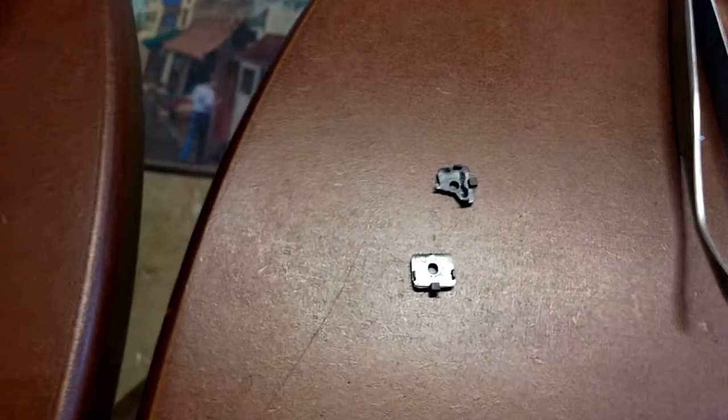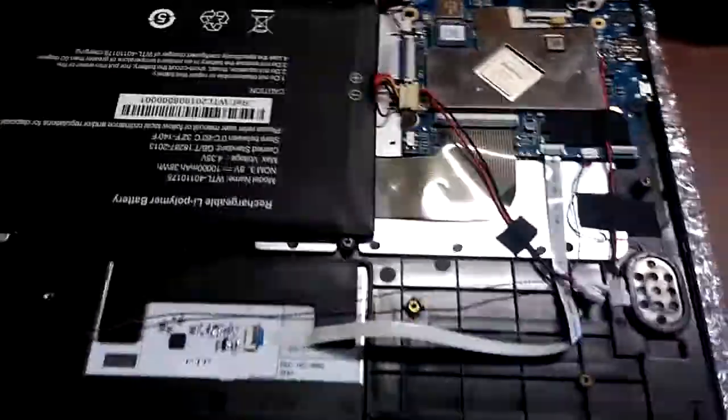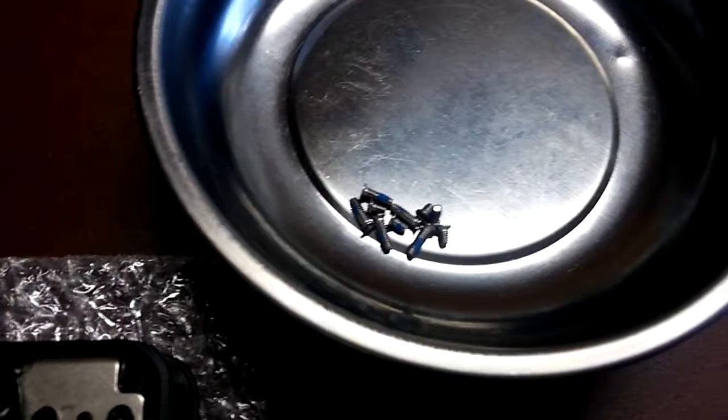These are some little plastic pieces on the corners that ended up breaking. The touchpad is on the bottom. I took the bottom off of the laptop — you'll take these screws out. There are four of the shorter length screws and those go at the front when you put it back in.